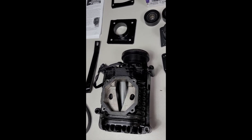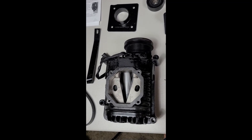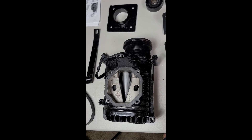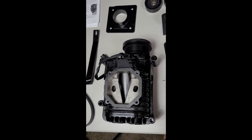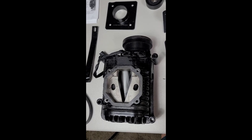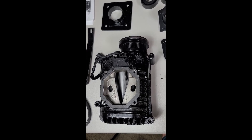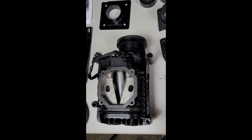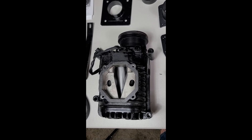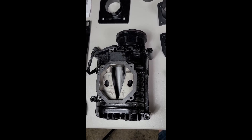This kit is designed to go directly from the supercharger to the intake. At full blast, this thing is supposed to produce around four PSI — not a lot of heat that needs to be cooled down to compress the air any further. Even if we did cool it down, we're really not going to get much more air in there. I'm only pushing three to four PSI at maximum RPM anyway.